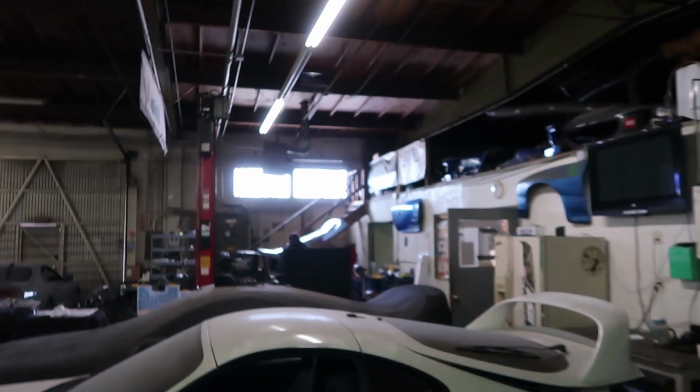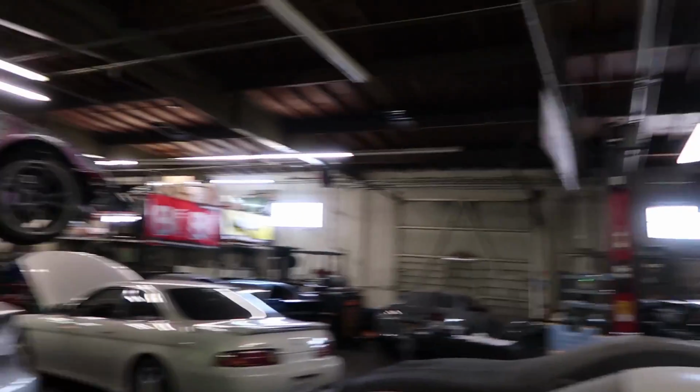So I'm gonna start working on the engine harness, the chassis harness, and the connecting part of the engine harness to the PDM and chassis harness. Actually no, the engine harness, we're gonna see if Rywire can help us do it because he's local, does really good wiring. He's gonna come by the shop later tonight. So I'll work on what comes out of the ECU to the bulkhead for the engine harness, what comes out of the ECU to the bulkhead for the front chassis harness, and then what comes out of the ECU that goes to the PDM and then connects from the PDM to the back chassis harness.